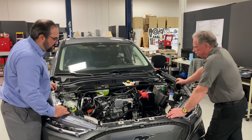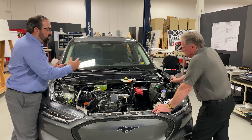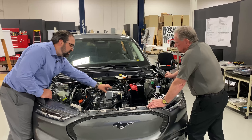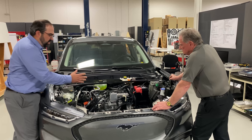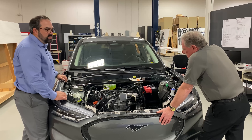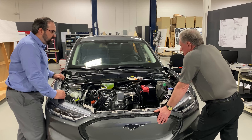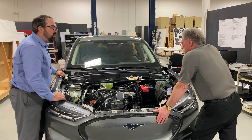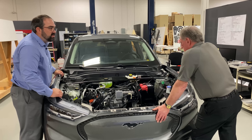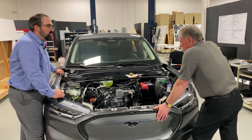We've got a couple of ideas. To use Electrify America, you are communicating with the charge port or with the charger, so every vehicle that works with Electrify America has this somewhere — it's probably integrated somewhere else on other vehicles. We think what Ford might be doing here is: they're going to be selling this in Europe, and they don't have the same Electrify America system or communication network. So it might be modular — able to take this off and replace it with another piece. They may have also had some packaging issues inside the battery control module or inside the converter and had to place it on top. Until we open up those boxes, we're not real sure, so it's still to be determined why it's its own standalone module.